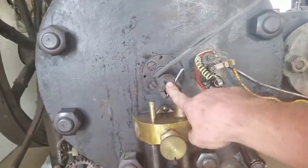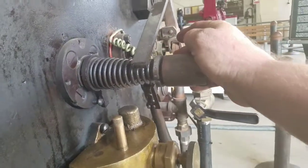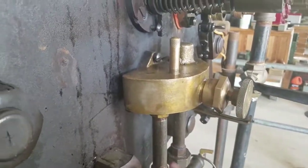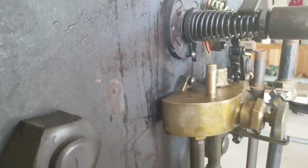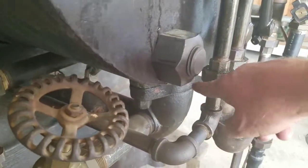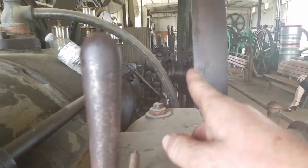Over here on the front, this is the intake valve. All it is is a relatively lightweight spring — I can push it in. And this is the carburetor here. This is a gasoline-powered engine. Internally, there's a channel where air comes in through this pipe here, comes up inside, gasoline goes in, and there's a venturi inside there.